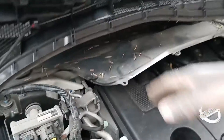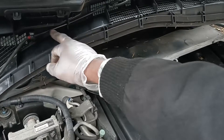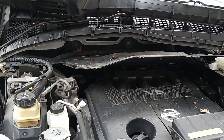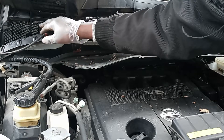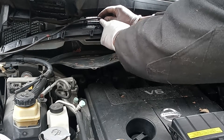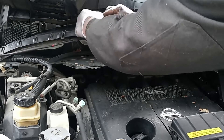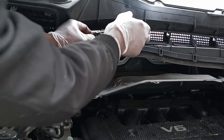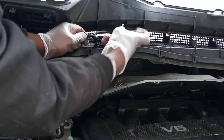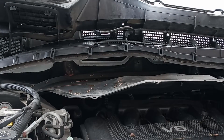As you can see, before you move it, you got these rinse wiper hoses. You got to disconnect these, so be really careful when you disconnect these hoses. What I'm doing right now, we're just going to remove these hoses first, move it from the connection. And right here we have the connection that we really want to remove. We just spin it little by little. We got to take time and pry it out between the hoses and the connection. After that, now I can remove everything.